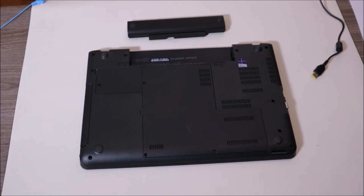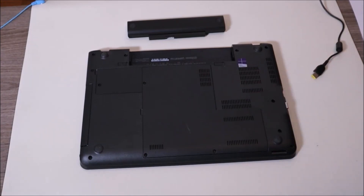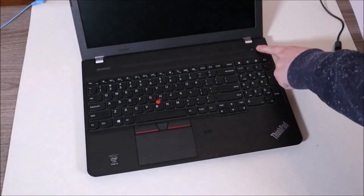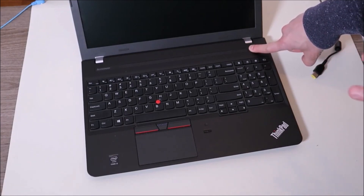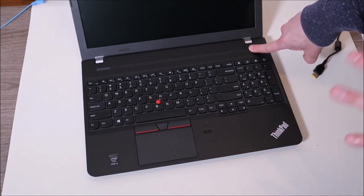If you do want to do this test the right way and your battery is internal and you can't get at it easily, there'll be a video in the description below on how to access an internal battery. Or if you want step-by-step instructions for your computer, leave me a comment with your brand and model and I can try to help. After you've removed the battery and unplugged your charger, flip your computer back over and press and hold that power button again for one minute. A lot of times power will build up in various components that shouldn't have it, and that can interfere with the computer even turning on. By doing this, we're draining the power from those components.